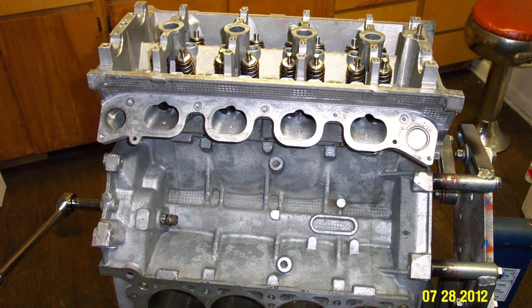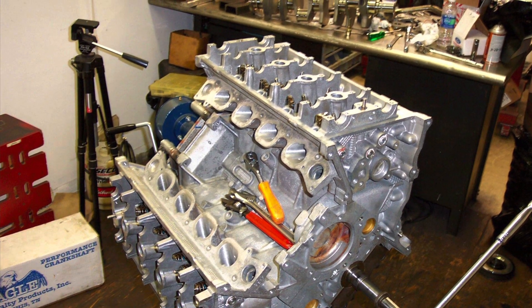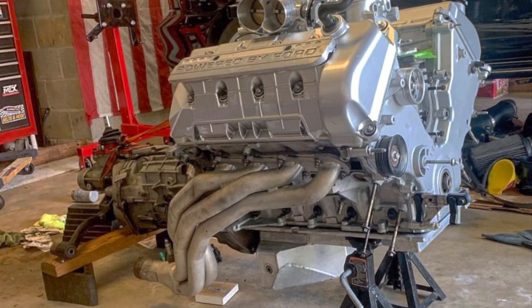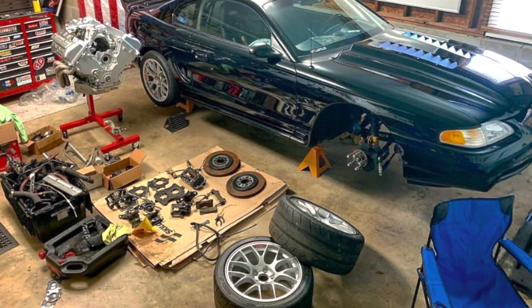484 lift, and right at 230 degrees of duration at 50. They're not super big cams. I wanted a broad, flat power band, following the theory of just make everything work efficiently and properly together.